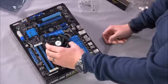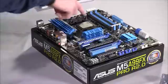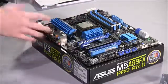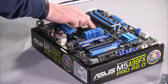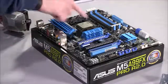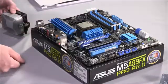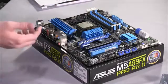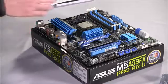is also pretty simple. You'll see on the motherboard that the AMD motherboards have these kind of brackets already pre-installed. For your stock heatsinks, and a lot of aftermarket heatsinks, they'll actually still take advantage of these brackets on the side. If you get like a Corsair H60 or something, or any self-contained water cooling kit, it may take advantage of these. There are some coolers where you have to remove these, and in Intel platforms, it's much more common for you to have to put something on the back of the motherboard. For our use, it's just easier this way as well for somebody who's building a PC for the first time, but we don't have to do that.